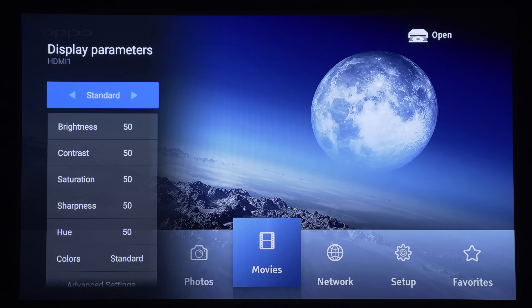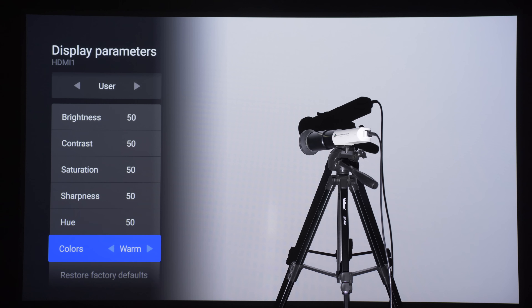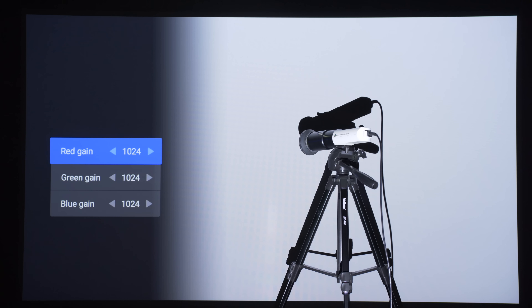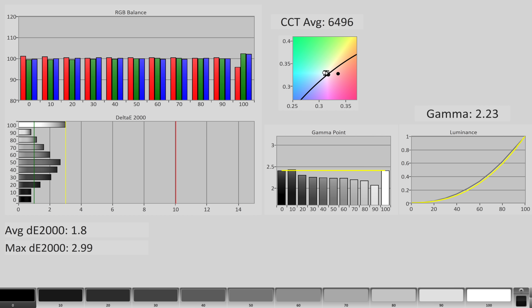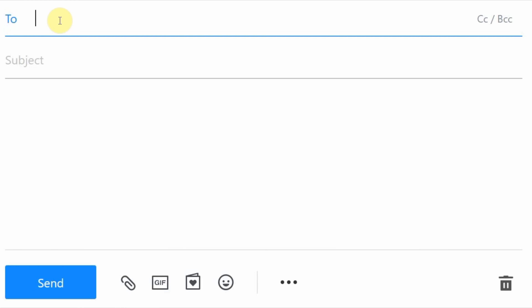Like other Xiaomi laser projectors, the Mi Jia effectively only has one picture mode that can be adjusted for calibration purposes. The moment you change any setting in any picture preset, it will populate the user mode. The Xiaomi Mi Jia 1080p projector offers only a single-point RGB balance adjustment, accessible by setting colors to custom. We used this to align the greyscale to the industry standard D65 white point, allowing colors including skin tones to look more natural than out of the box. If you purchased this projector from Banggood.com using our link in the YouTube description below, we will email you the calibrated settings we achieved on our review unit.